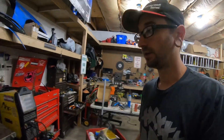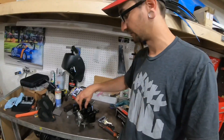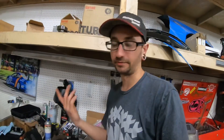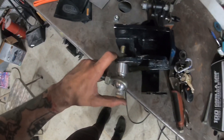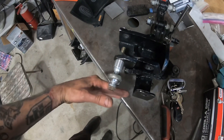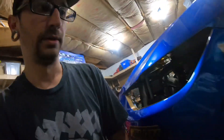The only thing I need to finish now is the lower pickup on this tie rod. I'm actually going to cut this off and straighten it — it bent slightly; you can see it curves a little up. I'll get that bent back down, then put a bottom brace in right there to tie it together and make it stronger. I'm also going to weld on a steering stop in the back.